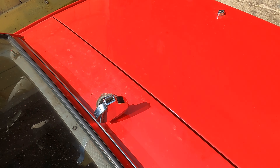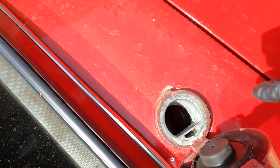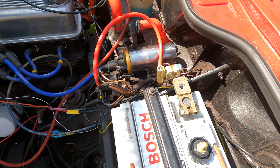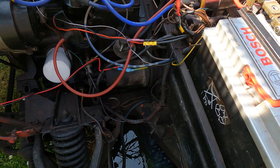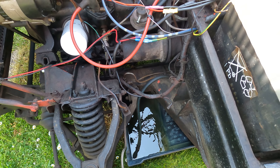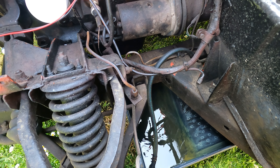Once you've got the tank, pop the cap — the tank was nearly empty anyway. You can just see a final amount of fuel in there. When it's empty, I'm going to remove the fuel, put the hose back on, reconnect the battery because I've disconnected it, and I'll turn the ignition on to see what the gauge actually shows. I'm not sure whether the sender unit has failed or whether it's the voltage regulator.